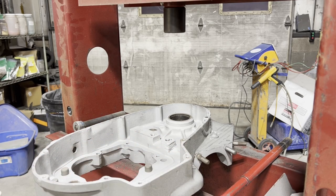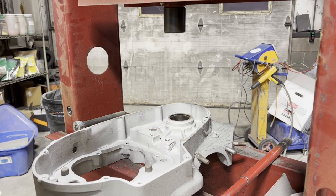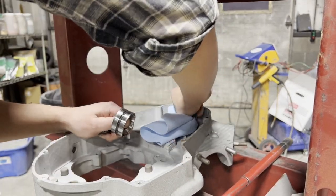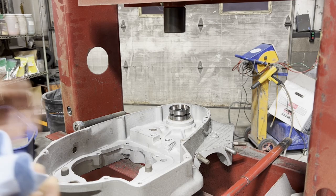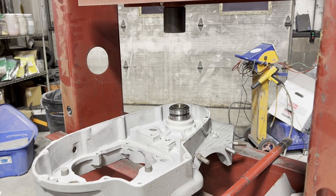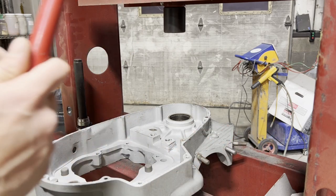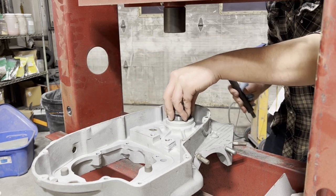Here's the bearing race we are going to be installing. Grab a rag, wipe this down real quick. The snap ring is seated at the bottom of this case — make sure everything is nice and clean, I don't want any debris in here. Since the case halves are split it does chuck up pretty well into the case. That's going to sit there. Now this is the old Timken bearing — I'm going to use that as a guide for the driver instead of trying to press it along the outside of the case. In the press, I'm hoping this will actually fit, though it looks like it will not.